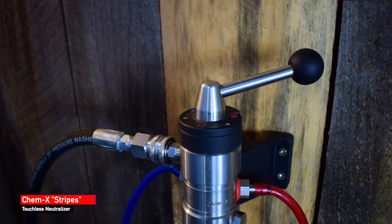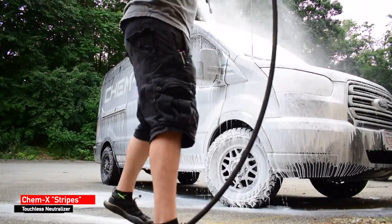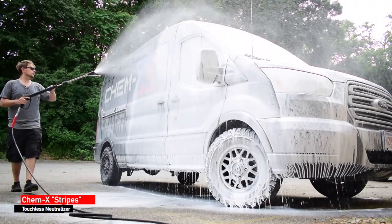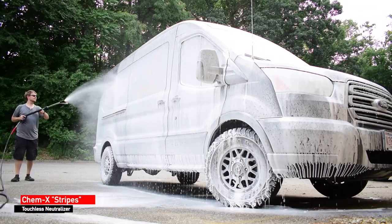Switch your lever over to the striped side. Go back over it again so they mix on the surface of the vehicle. Once they've mixed, just make sure you do manageably sized sections, especially if you have a lot of mirror-polished aluminum that's hot out and you want it to not get a chance to dry.